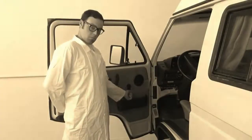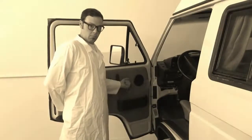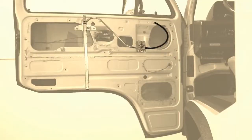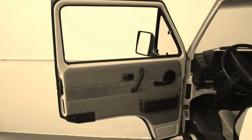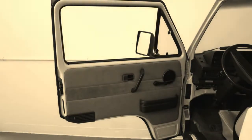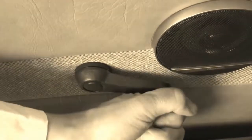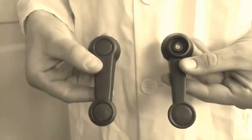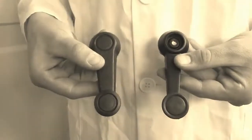As long as our regulator stays clean and free of debris, our window will operate fluidly. But if our window comes out of adjustment at the glass carrier mounting, or if the channels it moves through become blocked, our crank lever requires more force to move. The most common result if either of these problems are present is breaking the window crank. Even brand new window cranks were never meant to tolerate such force. We are unable to sell our window cranks with a warranty for this very reason.